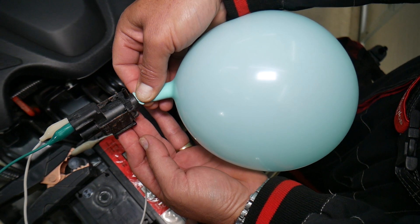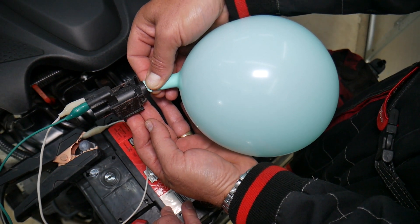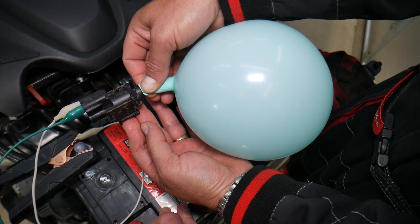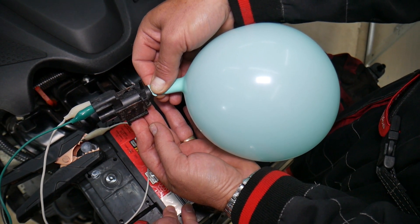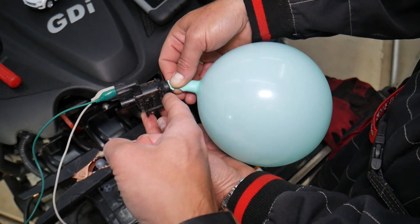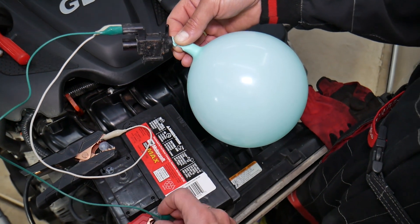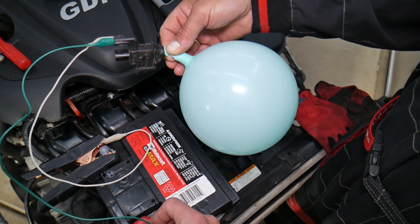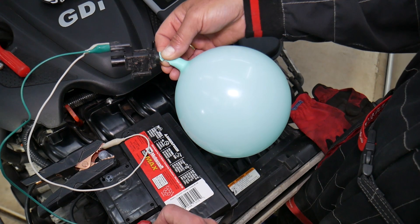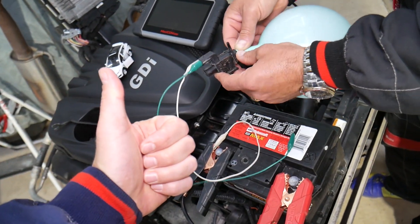While holding it open, the balloon slowly deflates — that means the valve is working. When we stop, it just stops. That's a good working valve. You want to make sure it closes all the way when closed, opens all the way when open, and that it actually opens and closes electronically. Hopefully this video is helpful to anyone trying to figure this out — thanks for watching and see you next time.